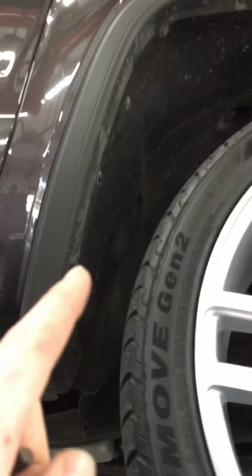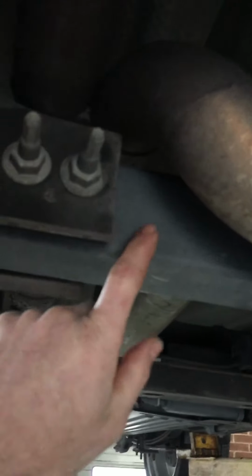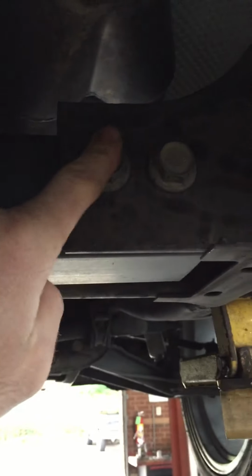I think that's about it underneath the truck. The easiest way to get to the header bolts and all that stuff is to pull the wheels off and the fender liners out. On taking the stock Y pipe out and getting this one in, you need to take the transmission cross member out. There's a nut in here that's a 15mm. You have this little rubber hose that needs to come off, and you have these bolts with a 21mm head and a nut with a 21mm head.